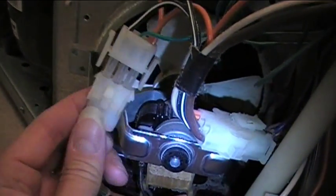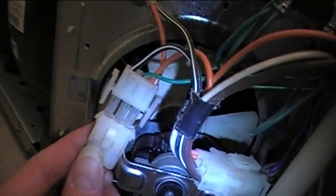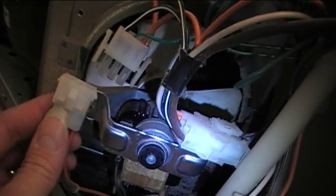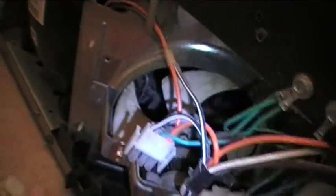Let's take a look at what it looks like down here. This is what the back looks like — here's the compressor, and here is the fan motor. As you can see, I have it disconnected. It was plugged in here but I've disconnected it because I don't want it to sit there burning up electricity, get too hot, and possibly cause a fire. So we're going to try to take that fan motor out and put in a new one.